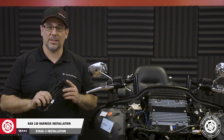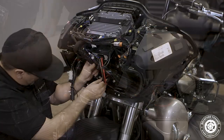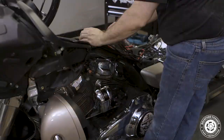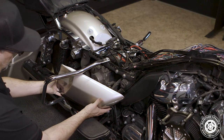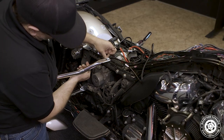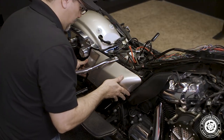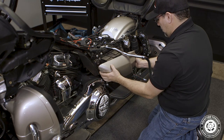Now that we have our speakers installed, we're ready to lay out our bag lid harness. First, route the harness up through the same retaining bracket we originally used for our power wire. Pull the harness up to the amplifier and verify there's enough slack for connection to the amp's rear output. We'll plug this into the Y harness we installed earlier that's splitting the rear output between the tour pack and bag lids. Finish routing the harness through the center channel on the right side, then remove both service panels so we can run our harnesses under the seat frame. Take the harness labeled brake side and route it through the service panel and exit toward the rear shock. On the clutch side, we'll use a half inch socket to slightly pull out the fuse panel and route our harness toward the rear belt.